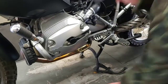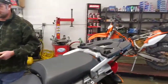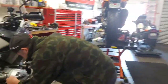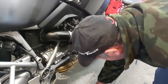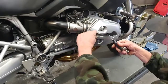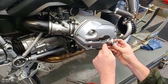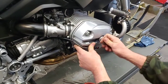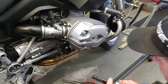I'm going to leave that and move to the other side to compare. I move the spark plug cover on the other side. With the small screwdriver, you take the wire out so you don't break the end. Then use the tool — sometimes they're very tight, so move from side to side to free it and then pull it out.